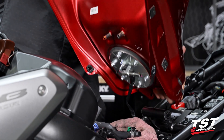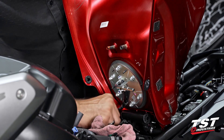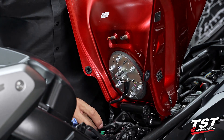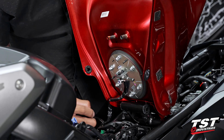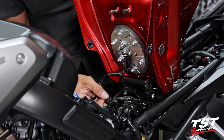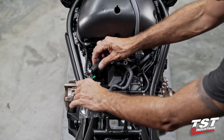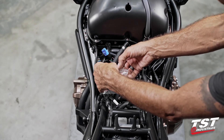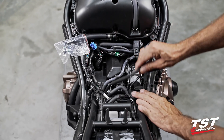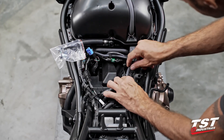I like to store tanks on used tires or something like that — that prevents anything from coming in contact with surfaces that may damage it. Actually, the tank is not quite free yet: you still have to unplug the fuel sender. Pretty simple — unplug, good to go. Now we'll get under this black cover. I like to put a clean bag around the fuel hose so we don't push debris towards the tiny jets and injectors. I'll unsnap this hose from the routing geometry.